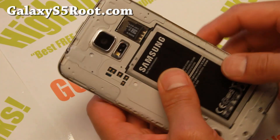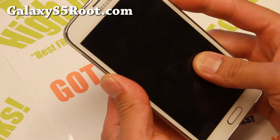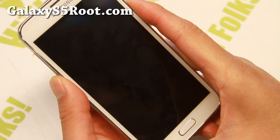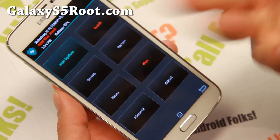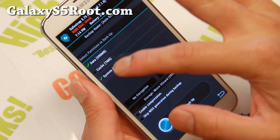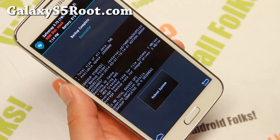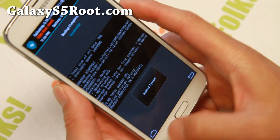First, you need a micro SD card and we'll boot into SafeStrap Recovery. I'm also assuming your SafeStrap Recovery is working — obviously it should be working if you've installed it, it doesn't just go away. Once it boots, I'm going to hit the recovery button to get into SafeStrap Recovery. What we're going to do is go to Backup and just backup cache, making sure you use the micro SD card instead of internal storage. This will create the correct TWRP Backup directory — TWRP Backups ED245B82 — it may be different with every system.